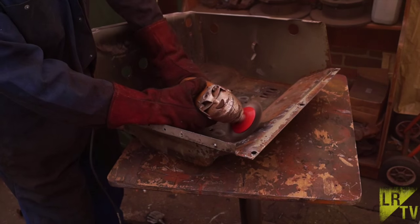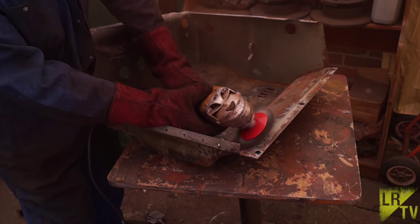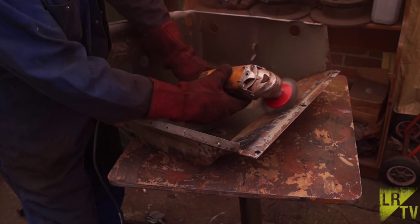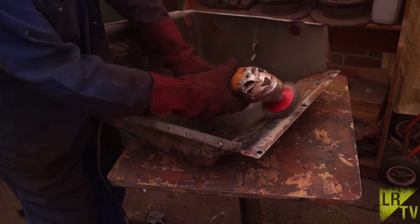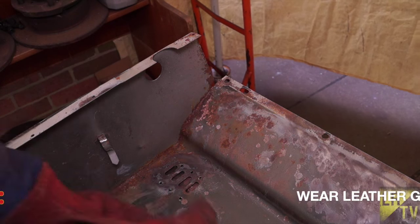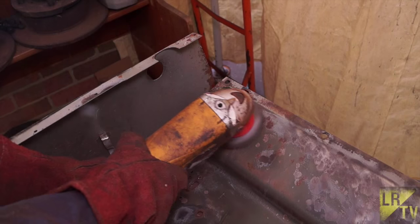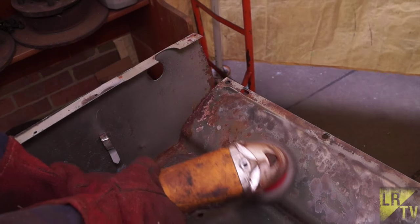You've got to be careful with this wire brush because it throws a lot of shrapnel at you, so point it away so it's working at throwing any debris in the opposite direction from where you're standing. You can see the sparks there. Wire pieces come off the brush very quickly. When using the grinder with no guard on it, keep your hands well away from the rotary brush.